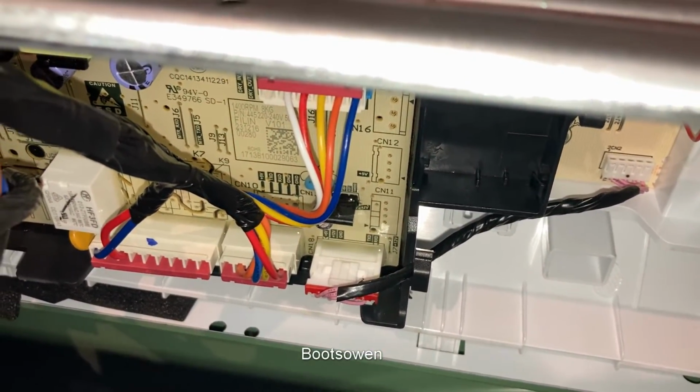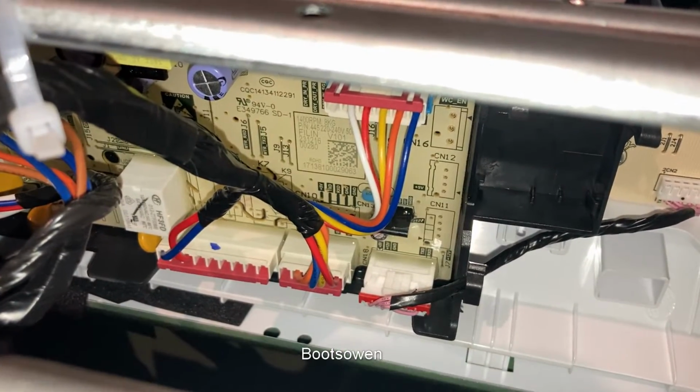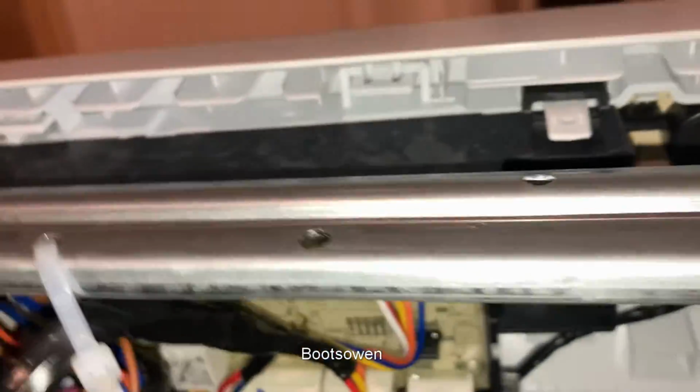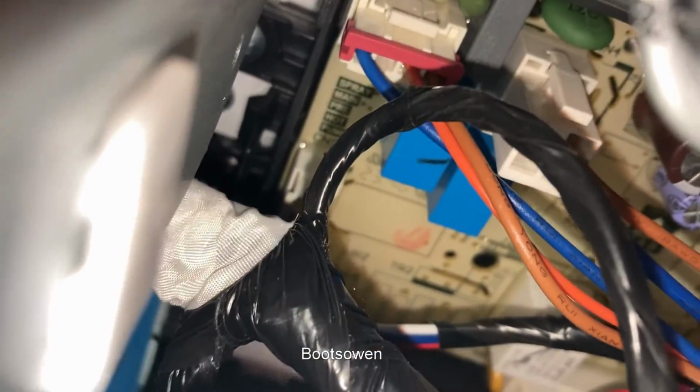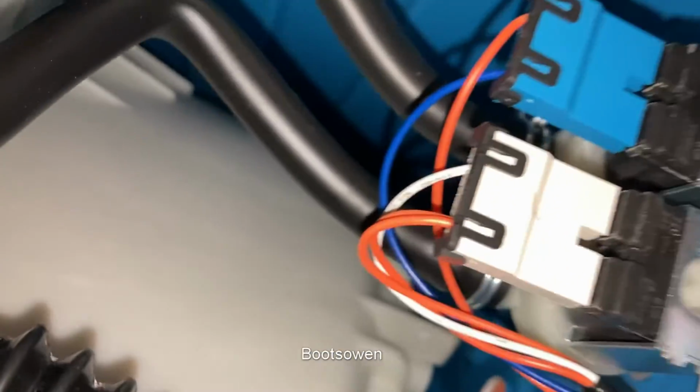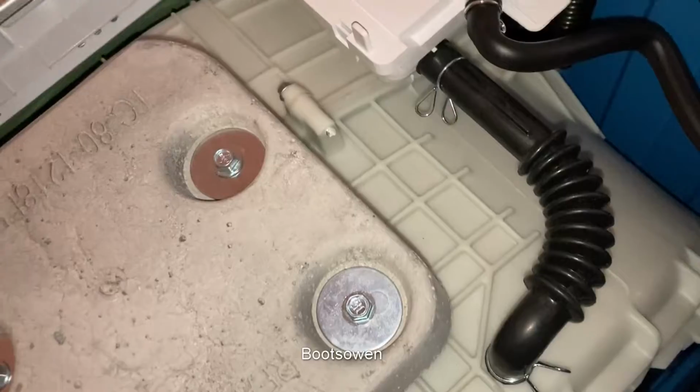So looking inside then, you can see the screws all around for that splittable tub, which is good. Door interlocks down there, can't really see very much of that. There's the back of the circuit board. It looks to be a kind of a universal board with some units populated and some not. There is a relay on it there. And there's two little blue, what they could be capacitors, but they could also be relays there. I can't see without taking it apart, and I don't really want to take it completely apart. So that might be a full control board on there. I don't see a control board down there, or down there at the back, which is where you'd often see one. Cold fill left and right for the pre-wash and main.